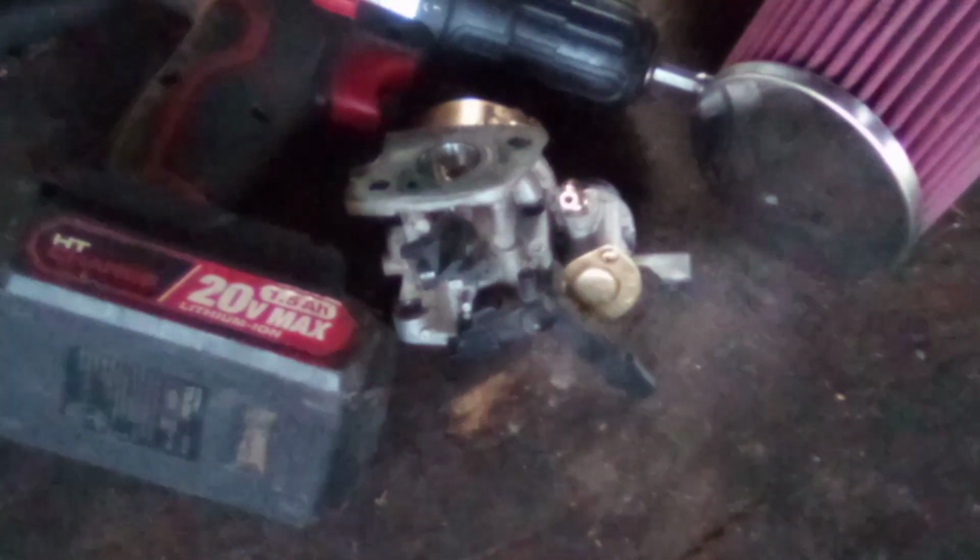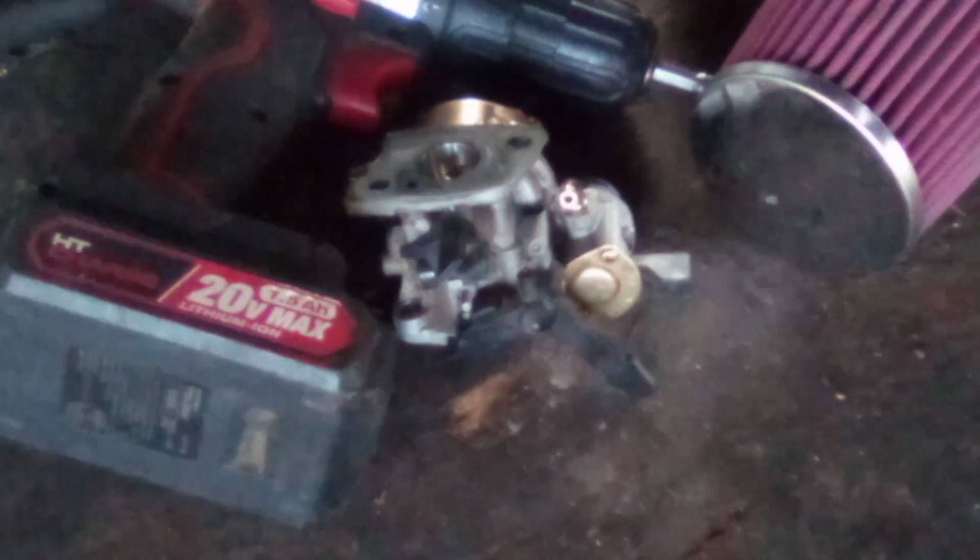Alright, well that gasket there's tore. Sorry, I'm not showing you guys that. I'm looking over here on the intake of the bike. The intake gasket's torn. It looks like it was torn before I worked on it. Somebody's tried to silicone it back together. So that's going to be a problem. I'll have to look through my stash and see if I've got one.